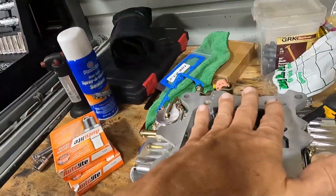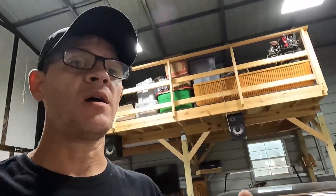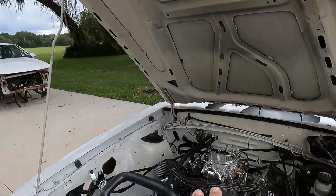Now that we've covered the bench adjustments, we're going to put it on the car. We'll set the fuel pressure first, then get it warmed up, and then go through the four corner idle. Set the floats first and then go to the four corner idle — I'll come back once it's warmed up and show you a few things.